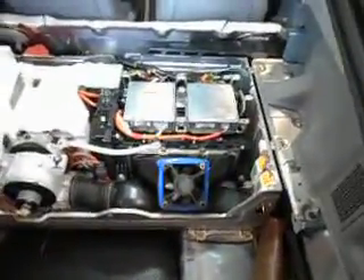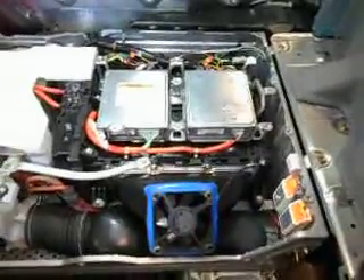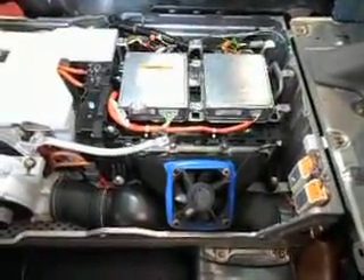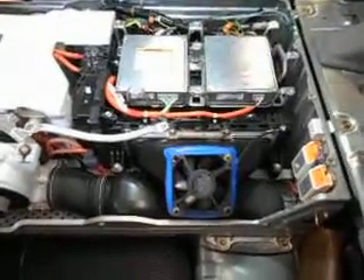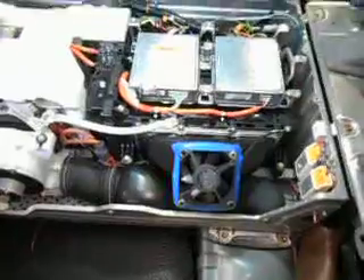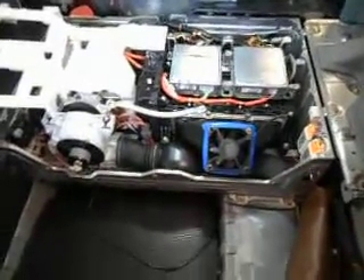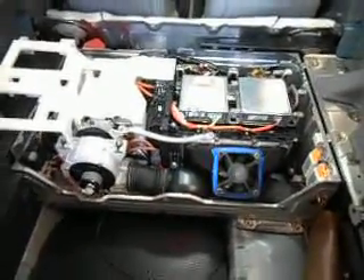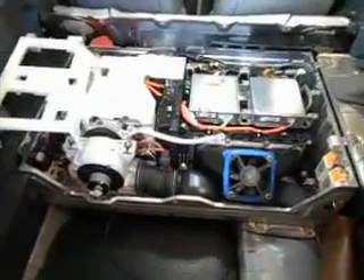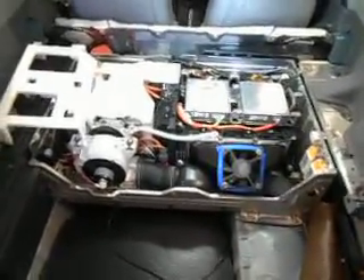Now I'm just going for a very quick test run in this car. The battery has had one complete extreme discharge — the 300R load was connected to the battery and left for 24 hours minimum, and the battery voltage was down to virtually nothing, certainly less than 5 volts. Then I recharged it using the simple 300 milliamp charge function and left it for 24 hours. Testing it now, it seems to perform very well. The battery is quite cold and I haven't tested the heater function yet, but having warmed it up driving around, it's giving 85 amps of assist and a steady 50 amps in fifth gear with foot to the floor, and the state of charge is holding very well. I'll report on further performance tests over the next few days.